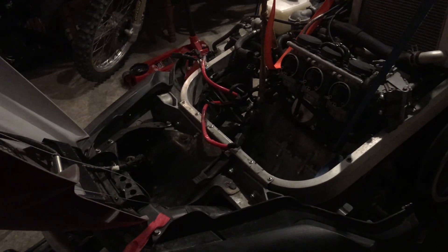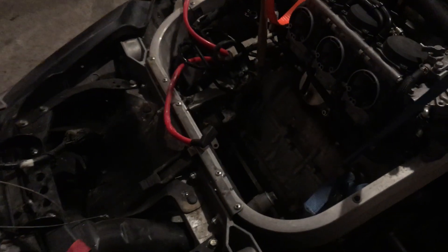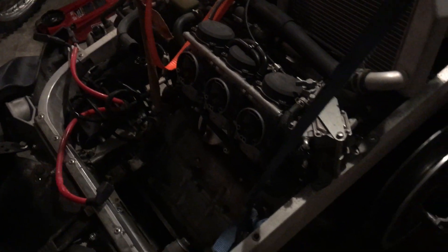So me and my father want to put a little video on just to give everybody a quick way to do it. What we've done first is remove the breather and the battery and the crossmember that goes through on the bottom there that holds the battery in place — the battery box. We took the primary clutch off.